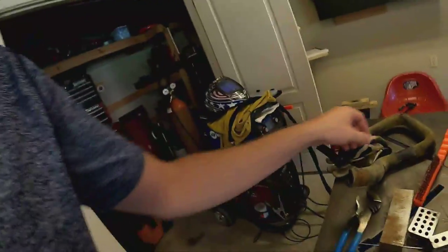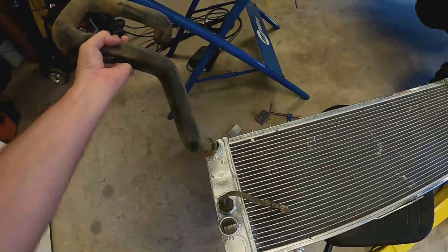Now I need to pressure test this. I'm going to take this old radiator hose - it's got an end that fits here and another end that fits there - mount it up, fill it with water from the filler neck, then use where the new drain plug goes: I've got adapters so I can put a Schrader valve there, then pump it up until water squirts out the vent. Once it squirts out the vent, I'll know there's 19 psi in there with the 19-pound cap. I also want to pick up a higher pressure cap tomorrow to test above operating pressure to make sure there are no leaks.